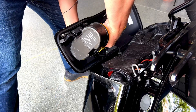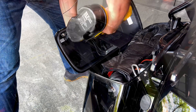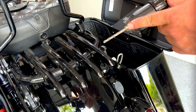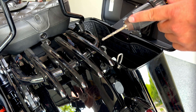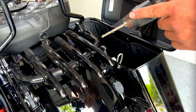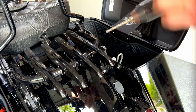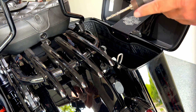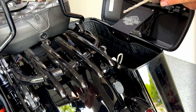We'll use this tiny 1/16 drill and drill those holes just to make sure we start with the right location. They recommend removing the bag for drilling — I tried to drill with the bag on and it actually works easier for at least one of the holes. Now I'm going to drill slightly bigger holes. The instruction requires 7/32 — I'm going to go one size smaller on the drill just to make sure the screws are really tight.